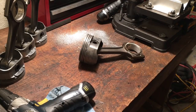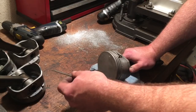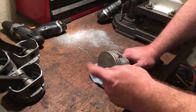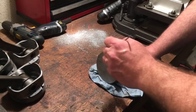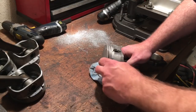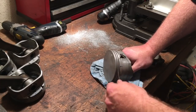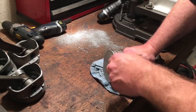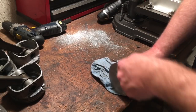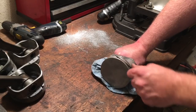That is the modification to add oil drain back holes to your oil control ring land to help stop stuck rings due to burnt motor oil. For a full piston cleanup, take your small Harbor Freight file — it's pretty fine with a nice point on it. The reason I use the point is because when you're working these piston grooves you'll find little pieces you need to get out that won't come with just a file or a broken ring. Take my file, put it in my top ring land and literally run it all the way around the piston.